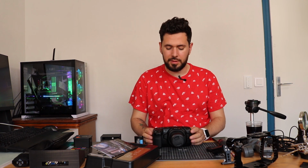Now let's talk about this camera. Video file size range is quite large. It goes from 5 megabytes a second at Full HD highly compressed to more than 100 megabytes per second at 4K 30 Hz, so presumably twice this size for 60 Hz video. So you are going to need high write speed peripherals to write on. High write speeds are quite expensive.